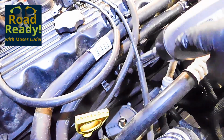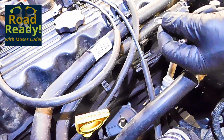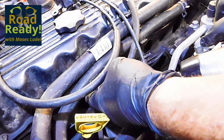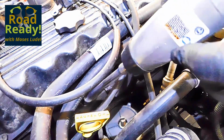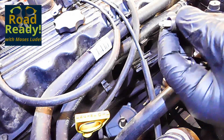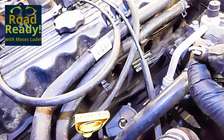Remarkably, these spark plugs have been burning cleanly. This engine does not use oil. That's one factor. The air-fuel ratios on an electronically fuel-injected engine are closely controlled. We seldom see any kind of fouling of spark plugs on EFI engines, and when they do foul, there's usually something wrong with the fuel injector system or some other components. A misfiring ignition would be another cause for plug fouling.